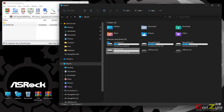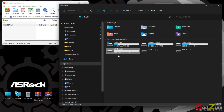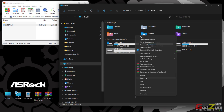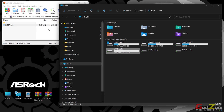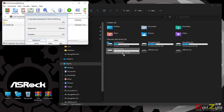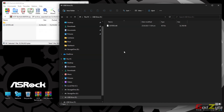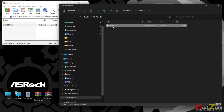Now this part is to prepare your thumb drive. Make sure it is USB version 2.0. Your thumb drive will need to be formatted as FAT32 — right-click and check the properties to make sure it is FAT32; if not, format the drive and set it to FAT32. Once done, extract the BIOS file from the Taichi download, copy this file over to your thumb drive, and change the filename to 'creative.rom'. All instructions from the Taichi board manual say to ensure the USB drive is FAT32 and to rename your downloaded BIOS file to 'creative.rom'. Once renamed, it's ready for you to do your flash.